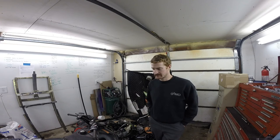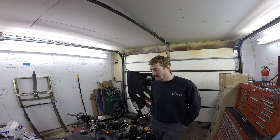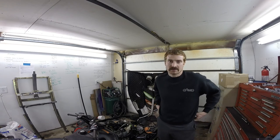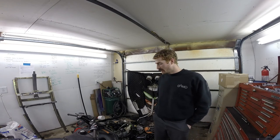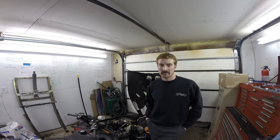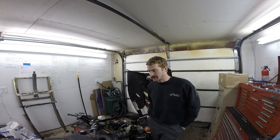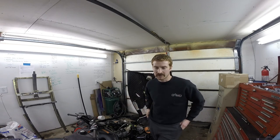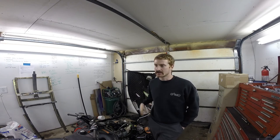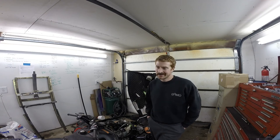Just bear that in mind whenever you're modifying these safety switches that it could be potentially dangerous. Even though I say I do everything by the book, we're not doing this one by the book — we're going to bypass some stuff and try to go racing this weekend. The other thing I've got to figure out is I got a case full of fuel — I bypassed my fuel shutoff switch and riding in a trailer a few times I suppose the bouncing may have caused a stuck float or some junk in a carburetor. Shouldn't be a big deal — I've got the carbs on the bench, they got carb kits last year, so I'm pretty confident we shouldn't have too much of an issue there. The main thing is going to be putting it back together and getting it running.